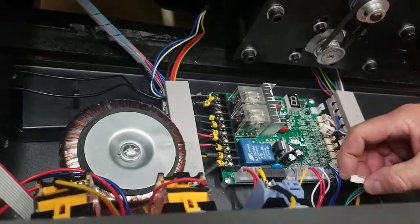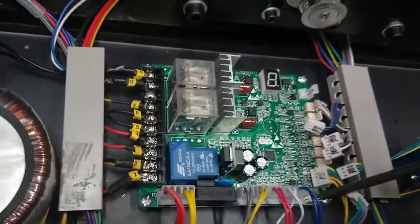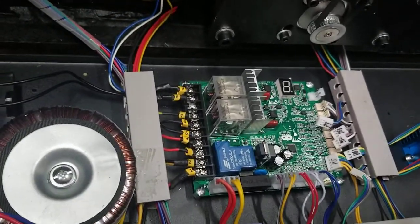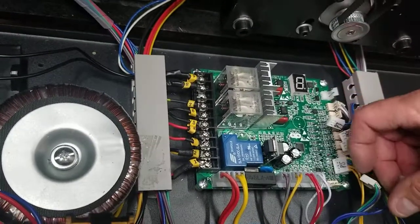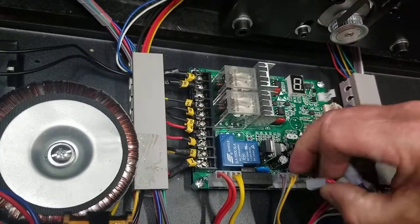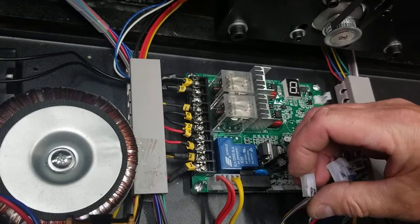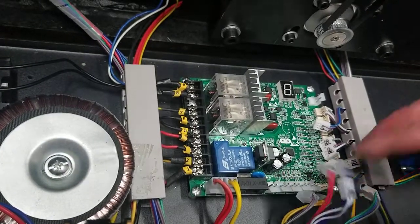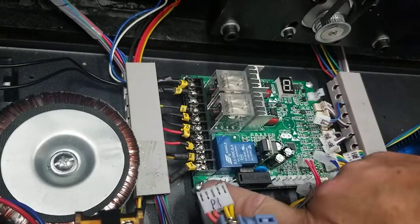You're just going to go down these — that's P4, also on the edge. These boards do change once in a while, so you've got to look for the numbers, they could be in a different place. Just confirm it and look for it. Looks like P34, and that's what it says in front. Then 33, P32, P31, and P2. And this one is obviously P1 — it's off to the side, it's a big plug so there's only one place for it to go.